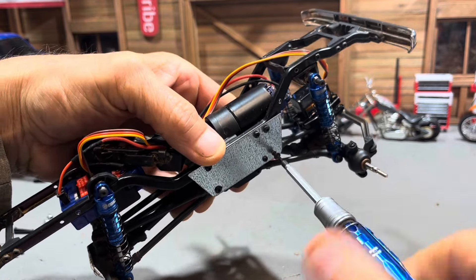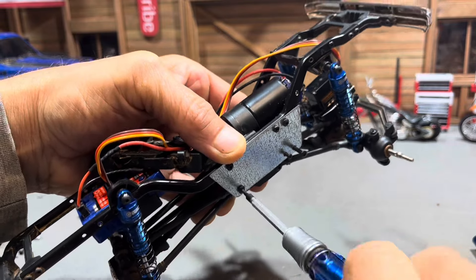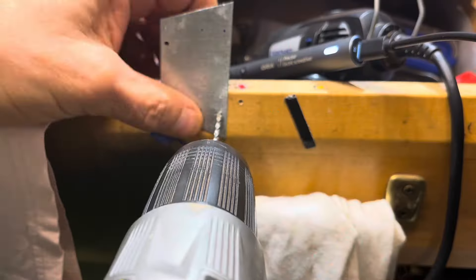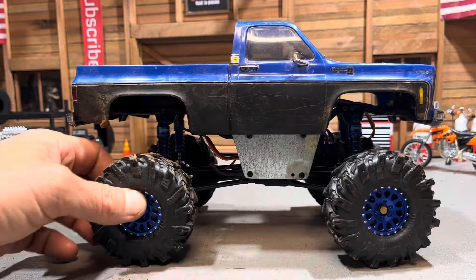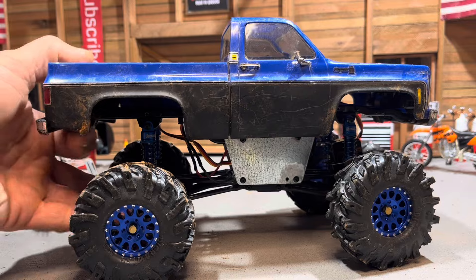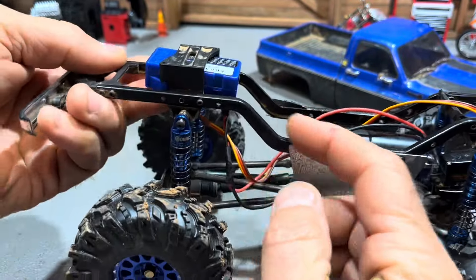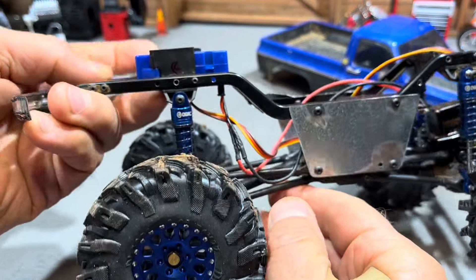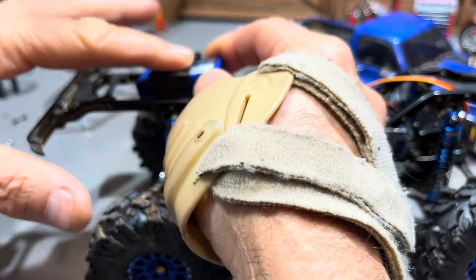But it's just not tall enough. I flipped the shock tower and put it underneath the chassis rail — I think that's where I want it. After making it even taller, I'm ending up with the same problem again: the driveline is at too extreme of an angle. So I'm going to have to redo these chassis plates — pull it all apart, cut some new ones, put it back together, make sure it all works and drives correctly. Then I'll pull it apart again, paint it, and do the finishing touches. To get something nobody else has got, you've got to be willing to do what nobody else will do.